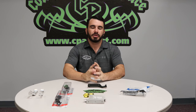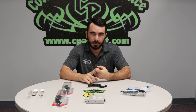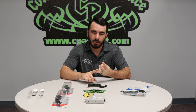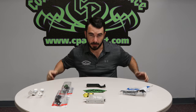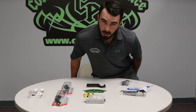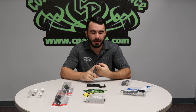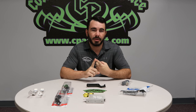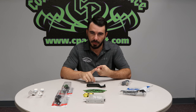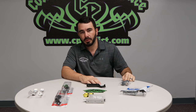First thing to do is take the door panel off the truck and check your cable assembly — make sure it's not stretched out, that's a really common problem. Look at your latch handle assembly in the door itself, and also look at your latch mechanism on the side of the door. Check your cable assembly for stretch and wear. Also check your latch assemblies — make sure they're lubed properly, not rusty, and have plenty of release action. Another big contributor is worn door pins and striker kit.